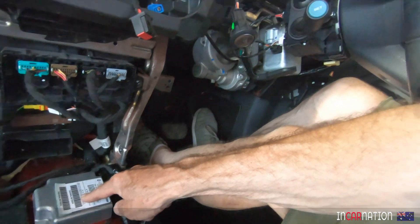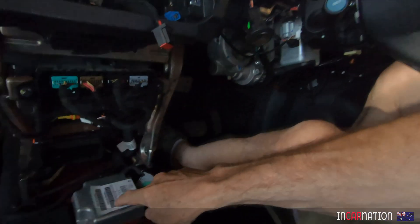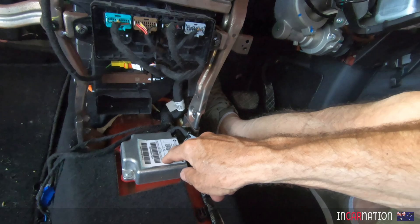The sensors know whether it's a front-on or side-on impact, and which airbags to fire. It's happily sitting here, and this poor person's had a crash - about 30km/h I'd estimate from the look of the damage. Nonetheless, that's enough for the sensors to register maybe 20 or 30 G's of deceleration. It might have cross-checked with another module, which agreed, so they fired the airbag and disabled the car. It's disconnected the high voltage battery and triggered a permanent note in the memory of that device.